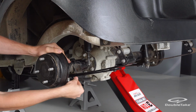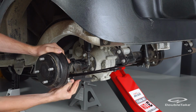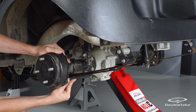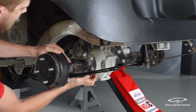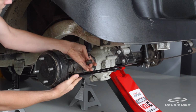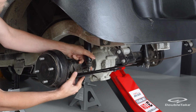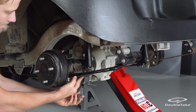Then swing the bottom factory U-bolt bracket up to align with the hex bolt under the heavy-duty spring. Next, pull the shock back down into the bottom factory U-bolt bracket and secure lightly with the saved hardware to prevent it from popping out of alignment with the hex bolt.